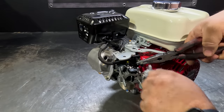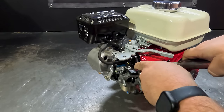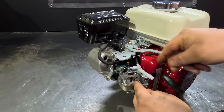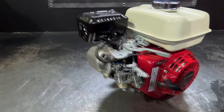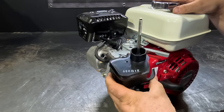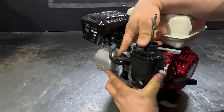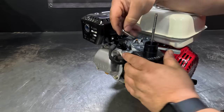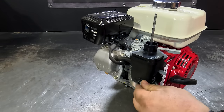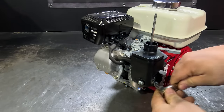Next, clamp the fuel line so there are no fuel leaks. Throw that fuel line back on your carby and then reposition the clamp. The choke lever sits right back on top, just like that. Then we refit that gasket and the air filter elbow, and ensure that the breather pipe goes back into the rocker cover if that was removed in the process. Put the one bolt in the top and the two nuts on the front and do those ones up.